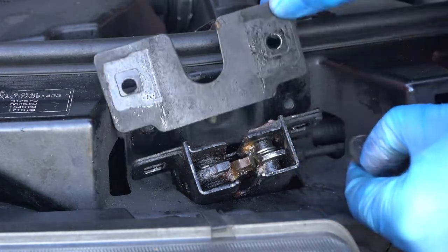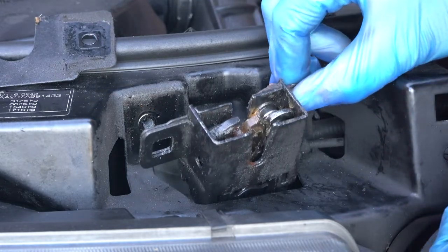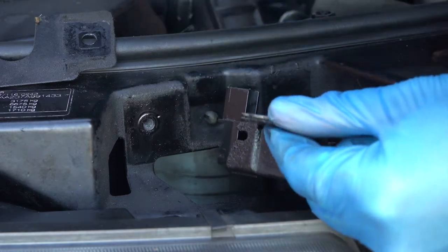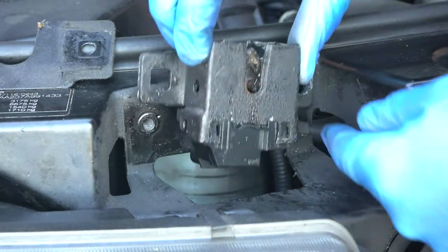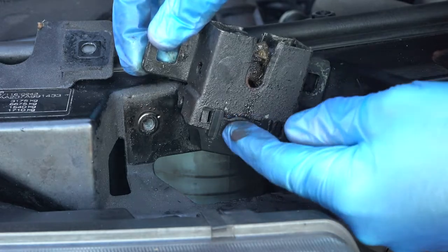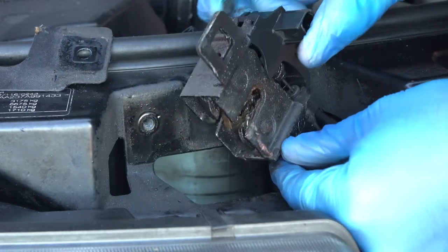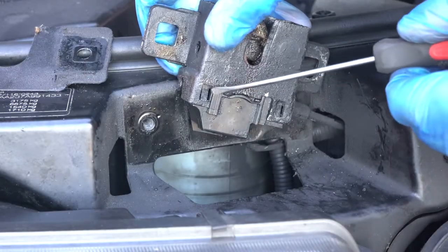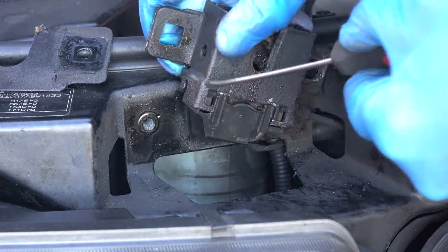There's a bit of a back plate here — I don't remember which way that goes. So now you can kind of see where that connector goes onto. The cable comes in here. It looks like I might be able to get the microswitch off the bottom without removing any more of this, which is good. There's a tab here and here — yeah, there we go.